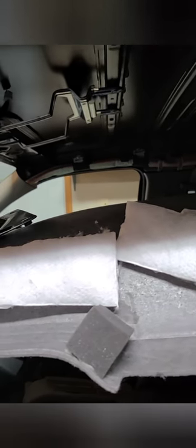So that's the reason I dropped the headliner, which is also kind of a pain, because I didn't like the idea of drilling without knowing what I was drilling through. And I'm kind of glad I did that, because if you look back here, you got your side airbag, some of your side airbag equipment here. And you can see how close this is to that. If you're not paying attention, you would be tempted to run this on this line right here, because that would make it very convenient. But if you did that, you would definitely run straight into that little airbag device there, which would be bad.